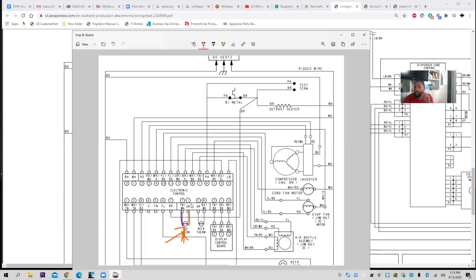To check voltage DC, you put the plug back in, plug the unit back in, go to your volt meter, put it on DC, and with the plug plugged into the board and the unit running, you take a live test measurement. That gives you something like 5 volts DC or whatever the chart says. You collect your voltage with the unit running and the plug plugged in, and collect your continuity with the Molex disconnected from the board.